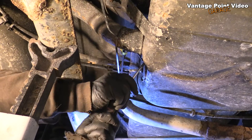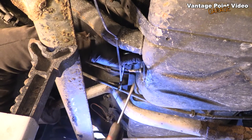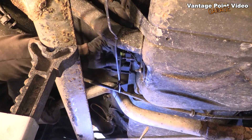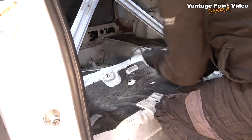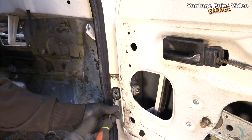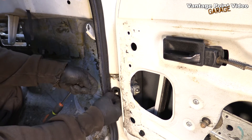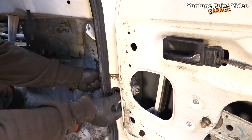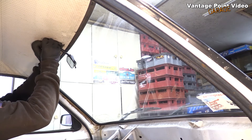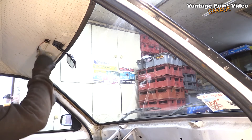Now that's the fuel sender wire. So I have to jack the car, support it, and use a screwdriver to get that one started — it's the earth, a little bit corroded. And that's the one that sends the current to the fuel gauge. Then there's the switch for the interior light that comes on when you open the doors — just disconnect that. It's fed right through the A pillar up to the light, and just pull that out, and the wire comes out all the way.